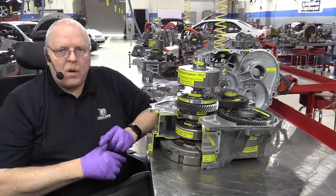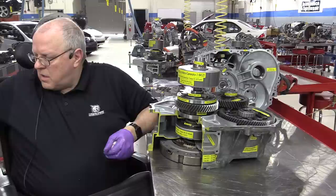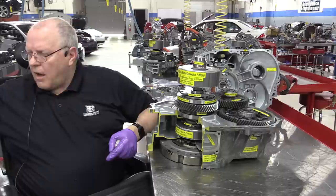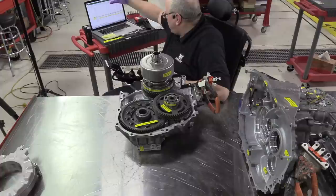In EV mode, you could drive clear up to 61.5 miles an hour before the engine had to come on, and I'm sure that had something to do with the rotational speed of MG1 and how much energy it took to even propel the vehicle down the road in MG2 versus the current availability from the battery itself. So I've done some calculations here. If I punch in 61.5 miles an hour,